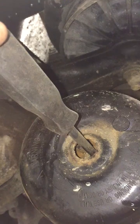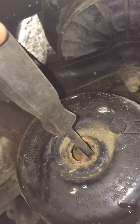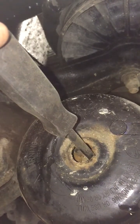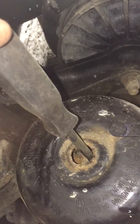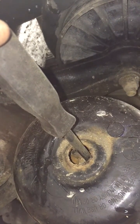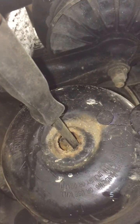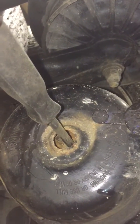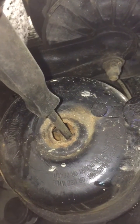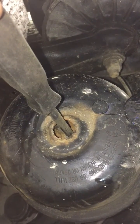The spring just moved. He's got 30 psi in the primary and 20 in the secondary, and the spring just moves. So you take that pressure times the diameter of this can — or the area of the can — and that tells you how strong the spring is. Customer complaint is this truck rolls away on the parking spring. That's how you test the spring, and that's broken.